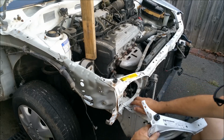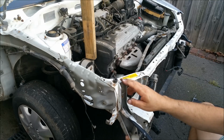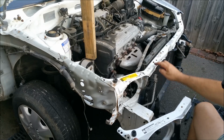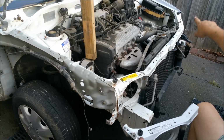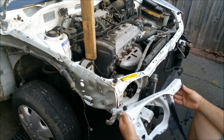We've got a couple of spot welds here. And where I've cut it, under there, is a brace. So I'll cut a V into it, which will wind up here, and I'll fill it with weld. I'll weld it right up, grind it off, paint it. I might paint the thing right along, actually, because the guards will be painted, so it won't look that far out of place. It'll be all sort of clean along the front. And I think that's the best way to go.